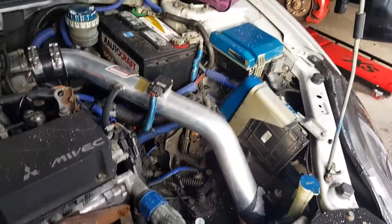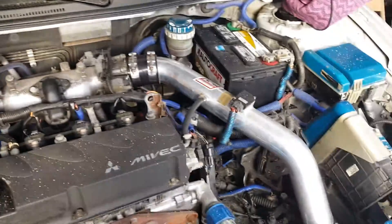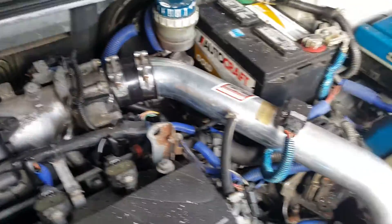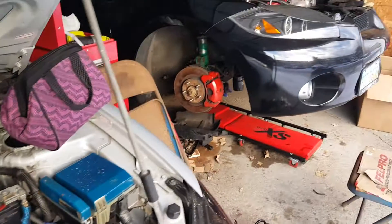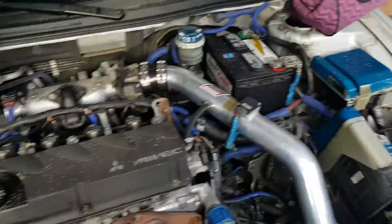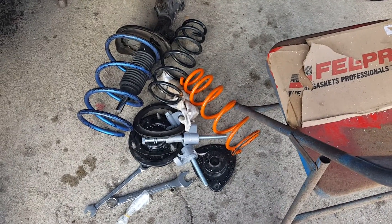I think it's because it had boost for so long — I have to change the intake manifold gasket, that's my next step. Everything's back to stock pretty much — if you guys have watched my previous videos — except that oil catch can. I even managed to find my intake manifold resonator that came off the black car and I'm gonna put that back on. The TN coils are finally on. I'm glad to say we're making some kind of progress. I'm done with this car other than putting the factory struts back on.